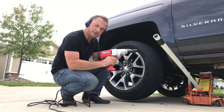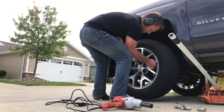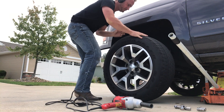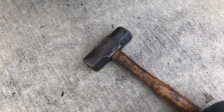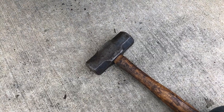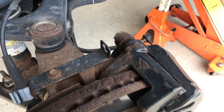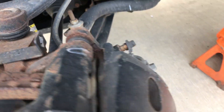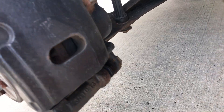I do have it in the air. I'm going to hold it to get them broke free. A 3 or 4 pound sledgehammer will come in very handy in the next process. Now that we've got the wheel off, we've got to get this caliper off. There's a bolt right there and one down here on the other side — those have to come off.